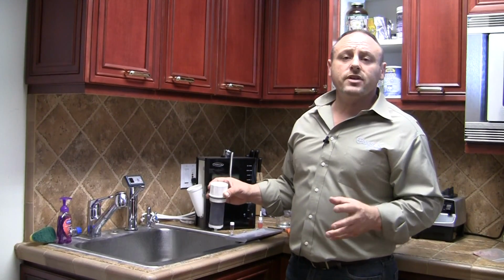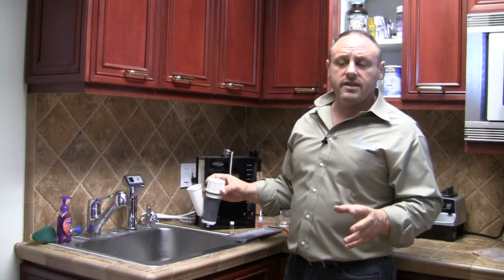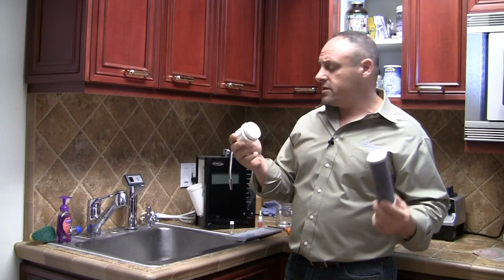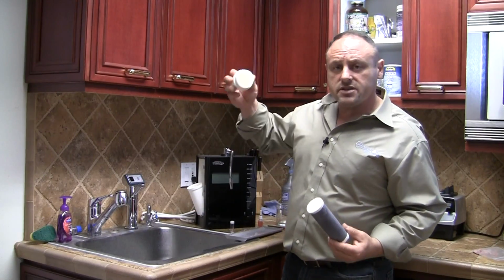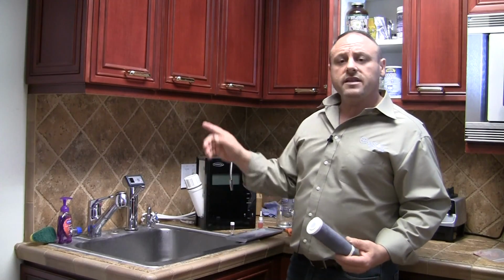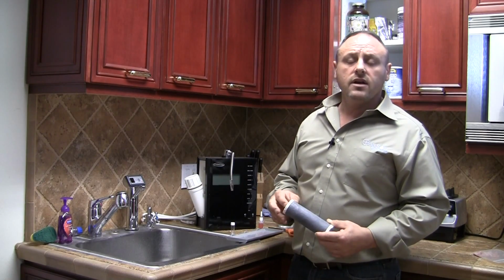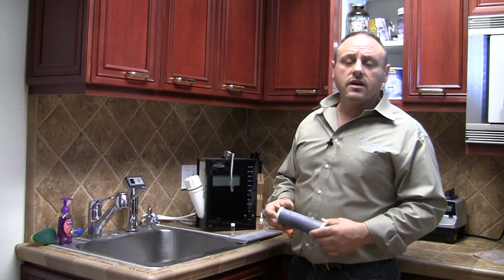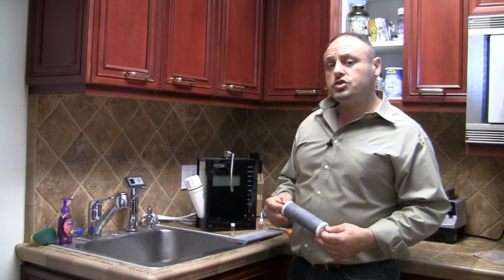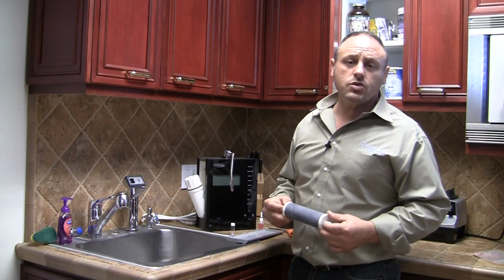We also have a citric acid cleaning procedure that I'm not going to go over in this video. We have it printed in very easy to understand language, and that simply consists of you removing the filter, putting the citric acid solution in this cup, closing it up, turning the ionizer on for about 5 seconds to let the citric acid go into the machine, letting it sit for about an hour, and then flushing it out. We like to see that done once a year for people that have average use in average hard water areas. For people that are in super hard water and have very heavy usage of their ionizer, we'd like to see you do it twice a year.